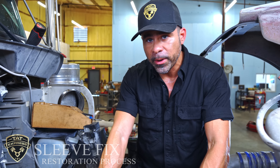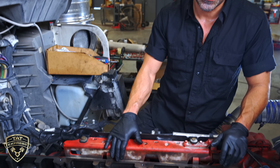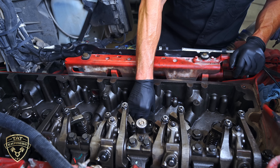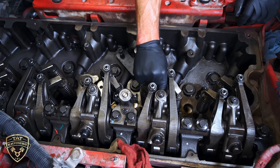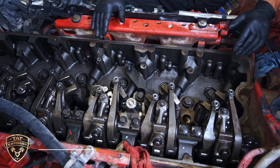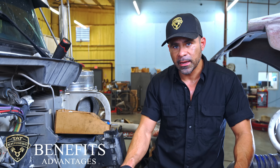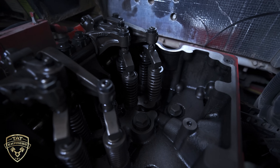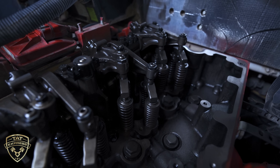This is a one-time repair, so if you still have a leaking injector sleeve after this repair, then you would have to replace the head. This tool goes here where your injector would actually bolt in. You secure it down and drive the retainer sleeve down into the bore, and it reseals your injector sleeve. This saves a lot of time and money — we don't have to replace the head. If it does continue to leak after installing the retainer sleeves, then we would have to replace the head.